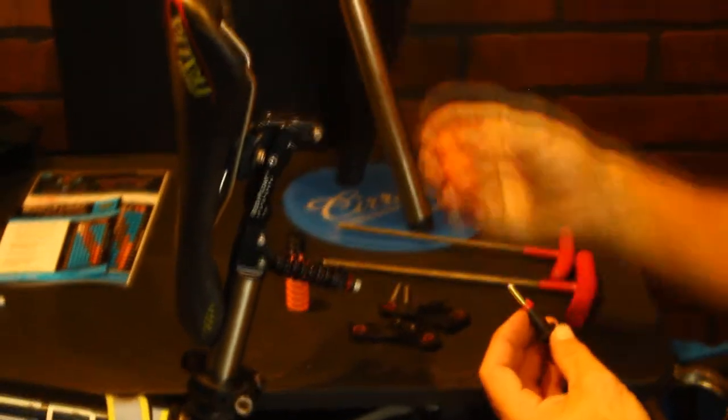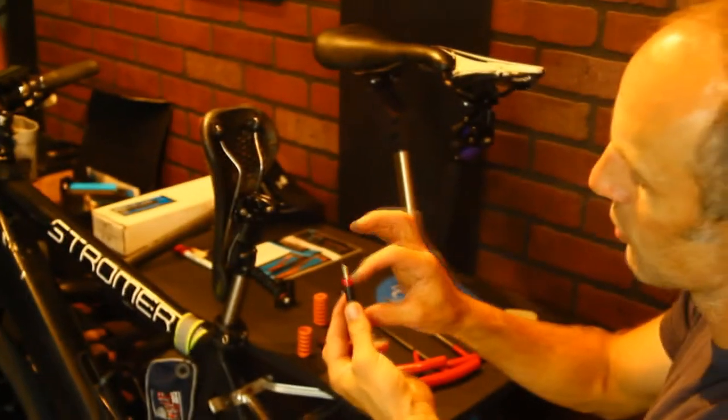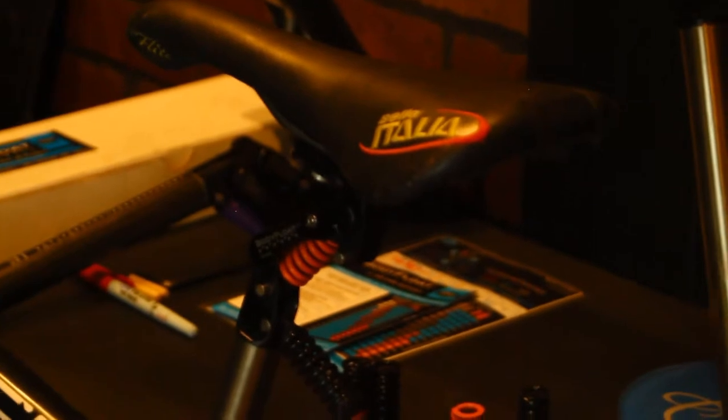I'm going to gently lean the seat forward, tilt the whole mechanism up, and my upper spring guide comes right out — very simple to do. Take my inch-and-a-half upper and replace it with an inch-and-a-half upper orange. On an orange-orange, orange upper, or black upper, you want to have two bottom-out elastomers sitting in there because the spring compresses a little earlier in its travel range. When you bottom the spring out, it hits the elastomers just before the spring itself bottoms out, so you get a nice soft lower end. Press this on, line up the end of the spring guide with the cap washer at the top, thread that in, press against the bottom of the spring guide right onto that dowel, and tilt that up. Upper spring replaced.